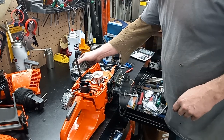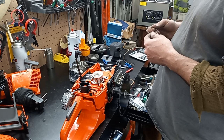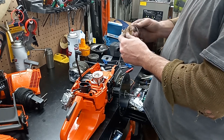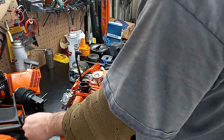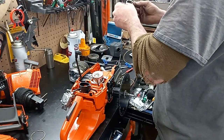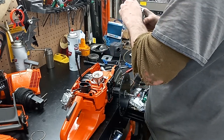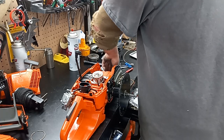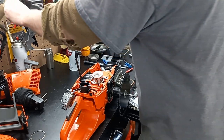I've got to find some other ring — I don't like the ring that came with this piston. It must be a really junky ring because just from the little bit of run time and dyno pulls I had on it, it has a razor sharp edge on the side of it. I don't think this ring likes the plating. I do not like the gap on that either — that gap is huge. This is a little tension ring and the gap is even bigger, so I don't know if that ring even fits.